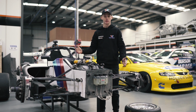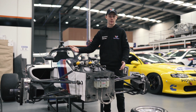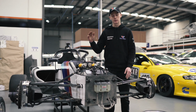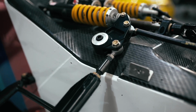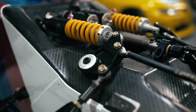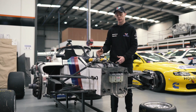And coming to the suspension. So suspension here is quite controlled for a race car. Very different to what you see in F1, supercars, all those other top tier categories. S5000 is pretty well made as a control package so that you can come in, buy the car and be instantly competitive. You have 3 different sets of springs you can run for both front and rear. Shocks all controlled and sealed so you can't actually adjust them yourself.